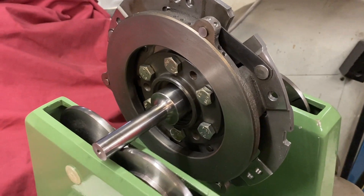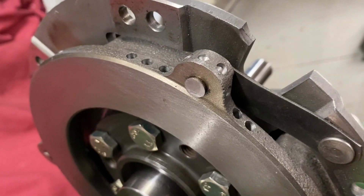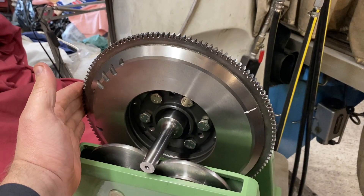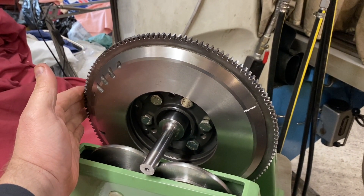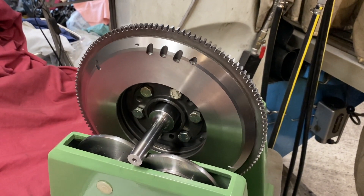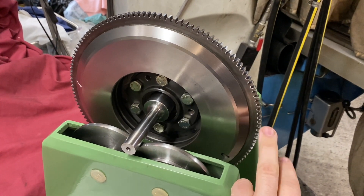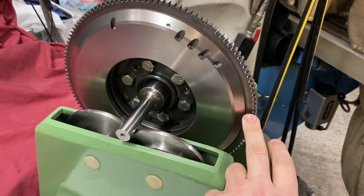The Verto pressure plate is now drilled into balance. As you can see, there are some holes in there — some of these are actually quite deep. They look like small holes but they go nearly halfway through, so that was a long way out. So with the Verto now, we've got the freshly lightened flywheel assembly attached to the diaphragm. You can see from the chalk mark that's the heavy spot. We try that for balance and we can see it's got a heavy spot there, so we're going to drill that into balance.